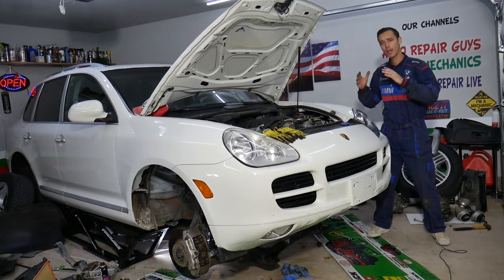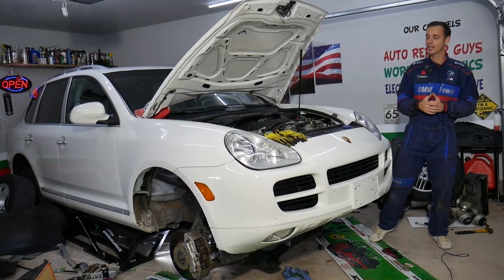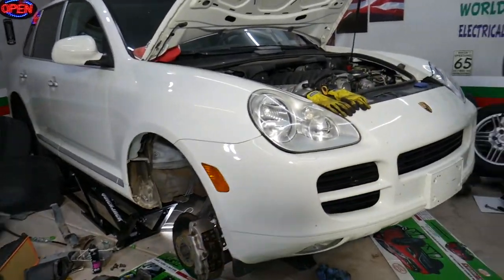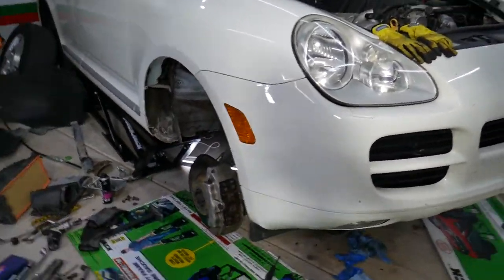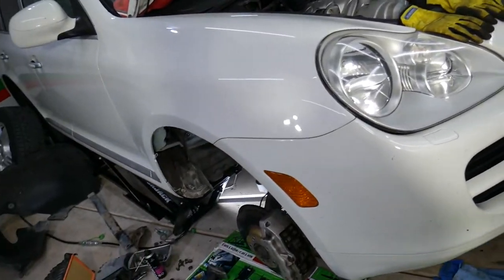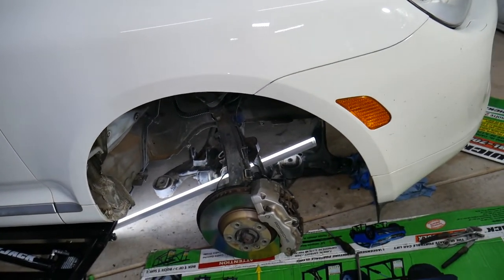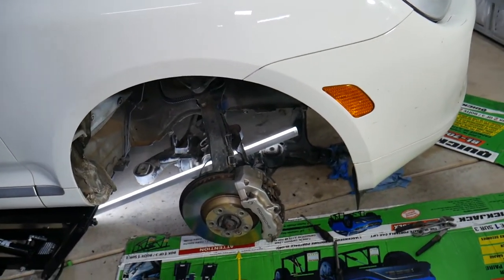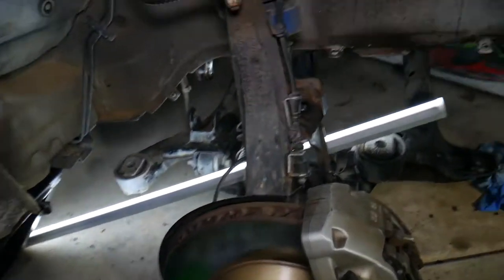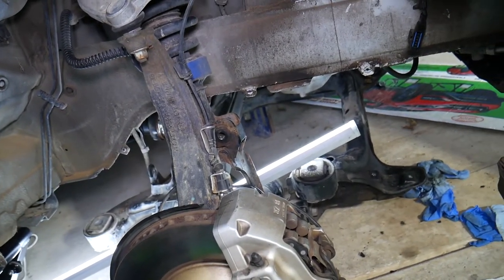You can see where we get all our tools and parts from at a really good, affordable price with very quick shipping. The Porsche Cayenne, Volkswagen Touareg, and Audi Q7 share the same chassis — suspension is practically the same on all these vehicles, especially the first generation. But for the rack and pinion, in order to remove and replace it, you need to drop the subframe, because otherwise you cannot pull it out.